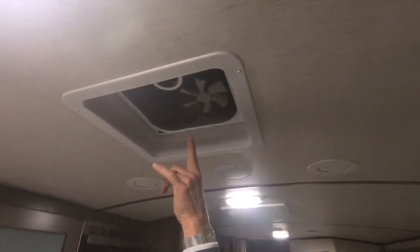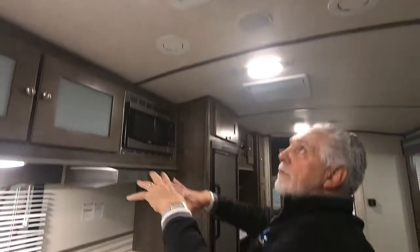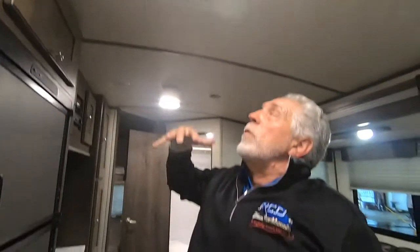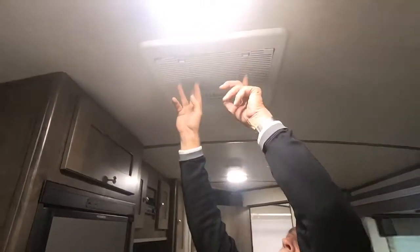Up in the ceiling you've got a vent fan right above your kitchen area that cranks open with an on/off button. Here's your air conditioning unit — it's got a cold air dump feature. Slide those open and it dumps cold air right here; the more you close them, the more it forces air out through the ceiling vents. There are two little tabs to release a door, and inside is your air conditioner filter — you can vacuum, wash, or replace it. In the Midwest, clean it two or three times a year; in dustier areas like Arizona or West Texas, check it about once every couple of months to keep your A/C efficient.